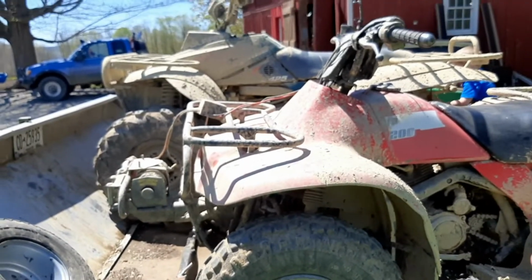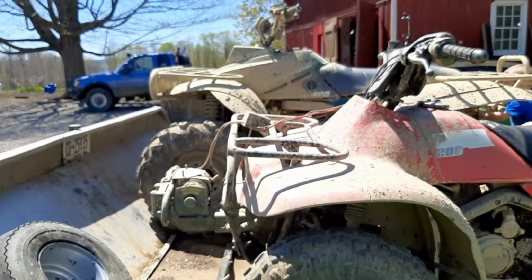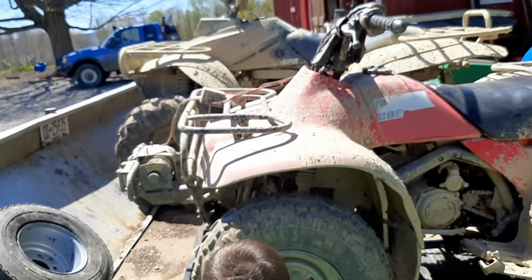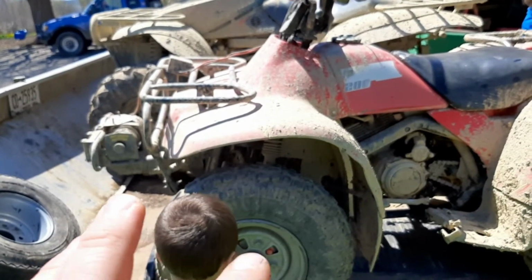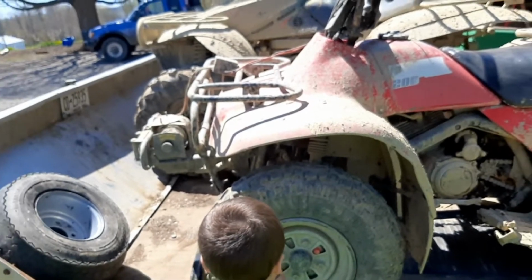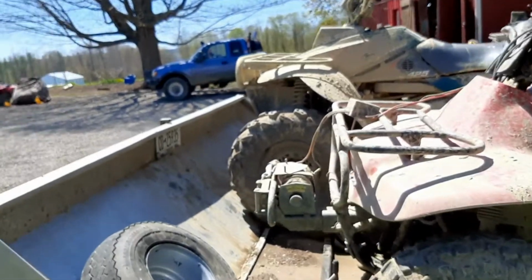And once you've done that, once they're actually very tight to the point they're almost dragging, you'll get very good brakes out of these. So that's very important, that they're adjusted all the way tight. If you take the wheel off, you're gonna have trouble sliding the drum on, and you'll think that it's tight, but it's not actually tight. You have some brakes, but not a lot of brakes if you do it that way.